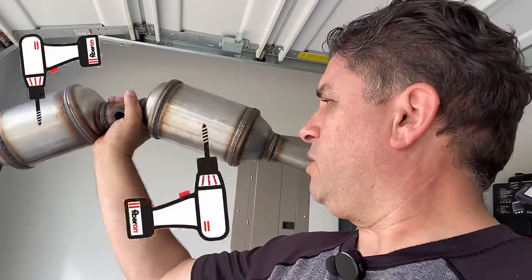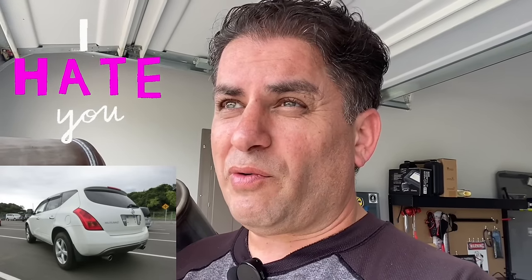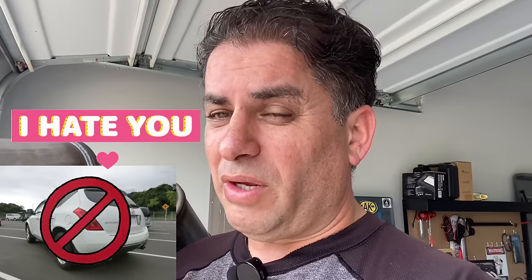You're not really supposed to buy used catalytic converters — in fact, they're supposed to be made inoperable by drilling a hole down the center of each shell. Honestly, unless your catalytic converter is stolen, I don't think you necessarily need to replace it. From my experience running auto repair shops for about 16 years, I've only replaced one catalytic converter — on a 2004 Nissan Murano that had been driven for many years with a random misfire on cylinder number one.